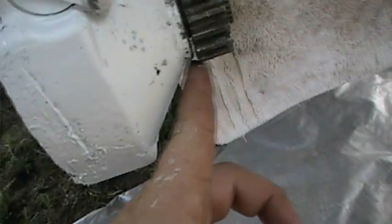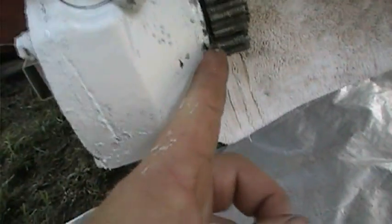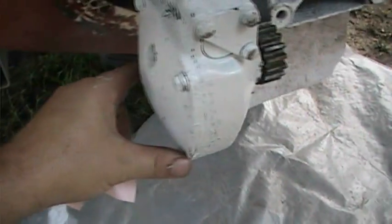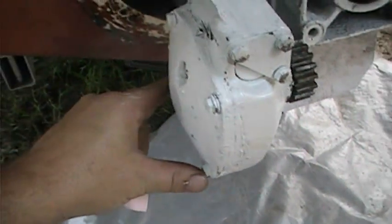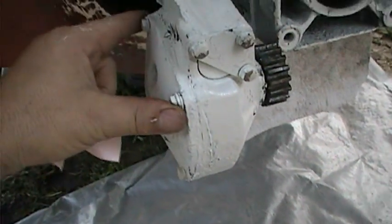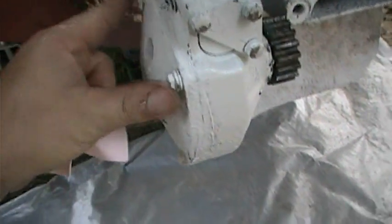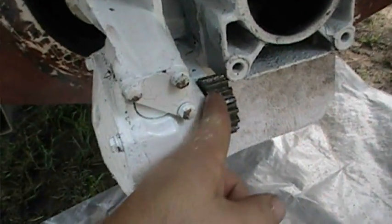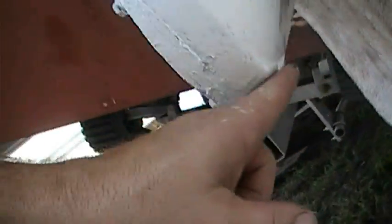I've got my small drip right here where most people see, and I'm actually missing a spacer there. I've known about the spacer being missing since the last time I had it out, which was approximately two months ago. There are four bolts that'll bolt in to hold this on — not too terribly tight. If you put it on too terribly tight, you bind this, and binding it doesn't help you a bit. You've got a nice little screw right down here to drain it.